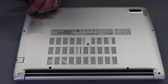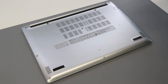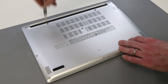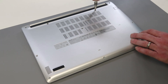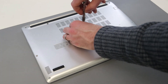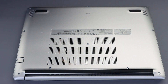If you're fitting a new SSD you'll need to either clone the contents of the old one or do a clean install. If you're adding a hard drive to the 2.5-inch bay for use with the existing Windows install, you'll need to initialize and format it through Disk Management. Overall, it's really nice that Acer includes the 2.5-inch cable and bracket. It's a fairly easy machine to upgrade — a little bit of a shame that the initial 4GB of RAM is soldered down, but overall a good upgrade experience. I hope you found this useful; let me know any questions in the comments below, links to parts will be included, and hit subscribe for more videos.